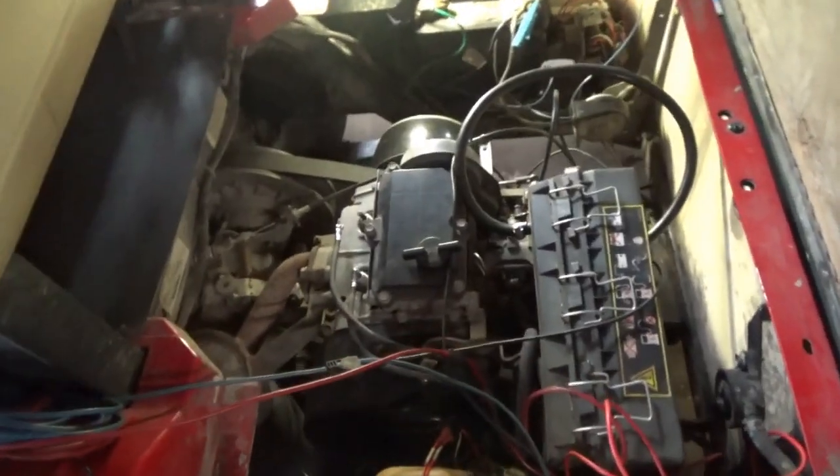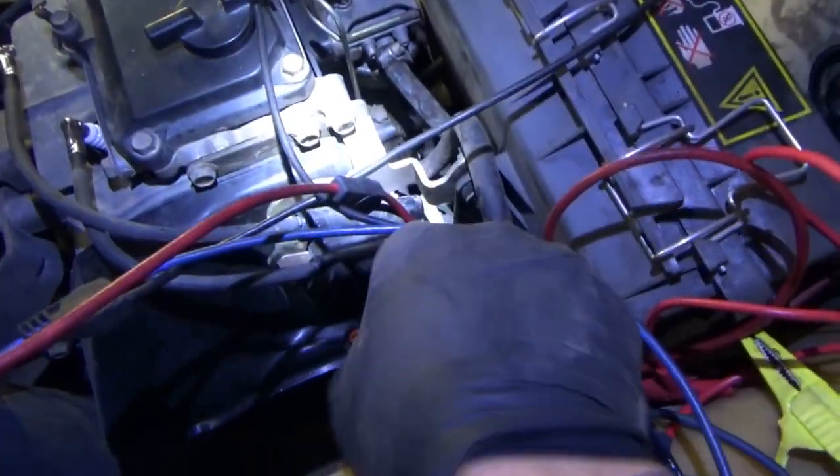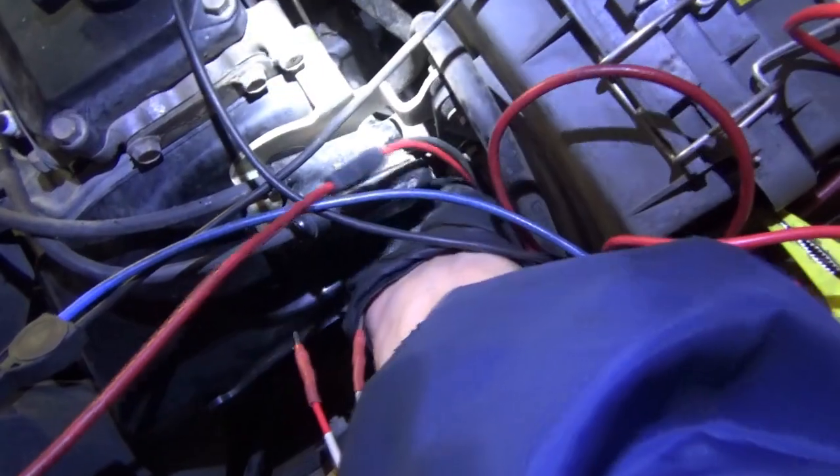So we ordered a brand new coil. The OEM coil is $200, but the owner wants it fixed. Plugged it in — still no spark, or very very weak spark. Sometimes you actually need to take the time and see what's going on with the voltages on both wires. The owner already tried a new igniter box and that didn't work, now we tried a new coil and that didn't work. This just shows you that parts cannon will get you every time.